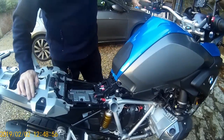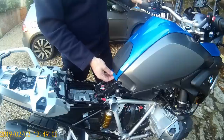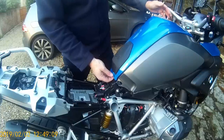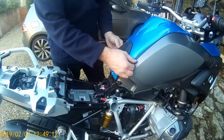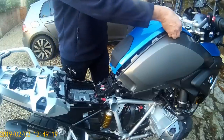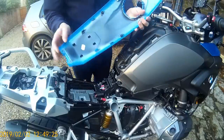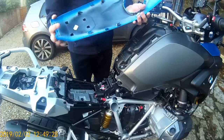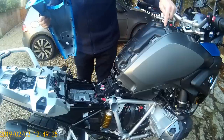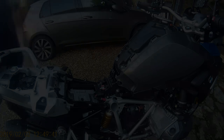This is the point where bravery comes in — it's a brand new motorcycle and nobody wants to damage it. The fuel cap is not part of this plastic trim, so pull it from the bottom and slide your fingers gradually underneath until it just eases up and pops off all its spring fittings. The fairing is now removed, exposing several more Torx 20 fasteners needed to get the side panels off the tank.